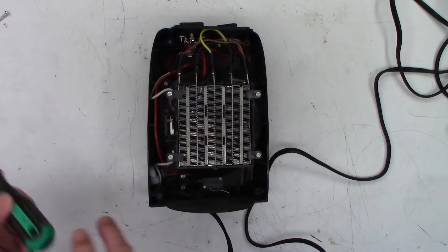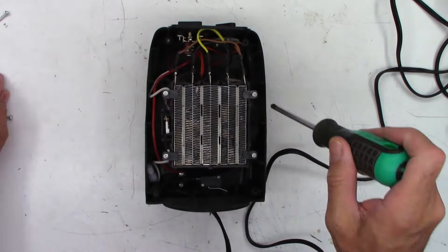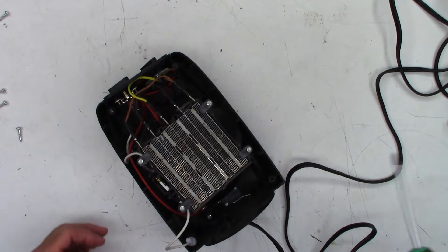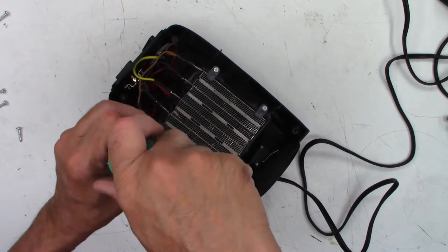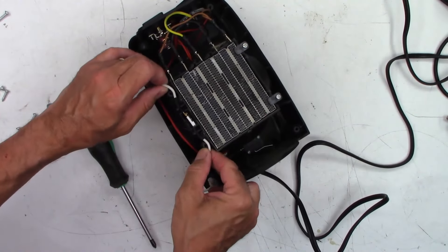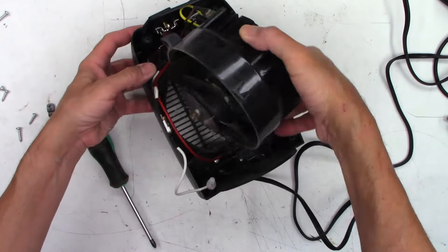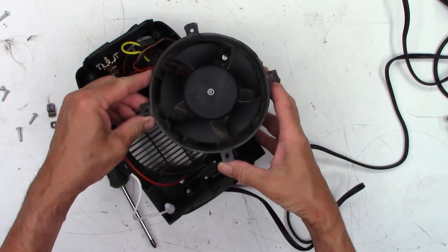Let's go ahead and try to get the fan assembly out. It's got too many wires stuffed up in there. There's a little safety switch right there, just in case it were to get too hot — it'll snap open. Hopefully, with that removed, this might lift up and we can get some of that hair off of there. Nasty, nasty. But perhaps you can see what I was talking about.